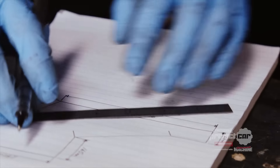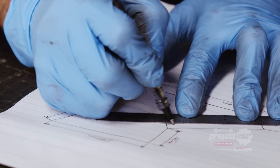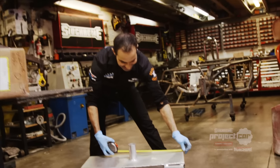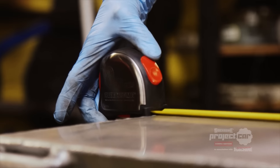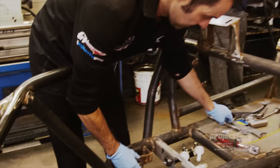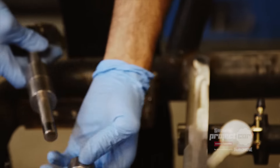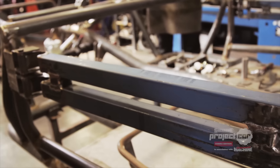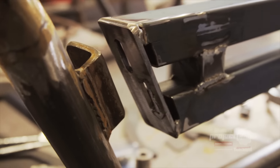George: "Tom's been involved in Python Vehicles for a long, long time now. Basically we need two things: we need to get an engineer's report and we need a roadworthy certificate. Tom's here to inspect the beginnings of the car and then do some specific testing." Tom: "First up, we'll do a torsion beam test to see that the chassis is stiff enough. It's going to be quite a powerful car and we want to make sure it's going to handle well. Beyond that, our role is to make sure the vehicle complies with all the safety standards it needs to. So you still need side intrusion bars and it's got to meet all the emission testing that a Corolla needs to meet."